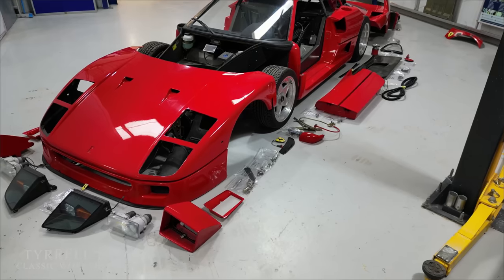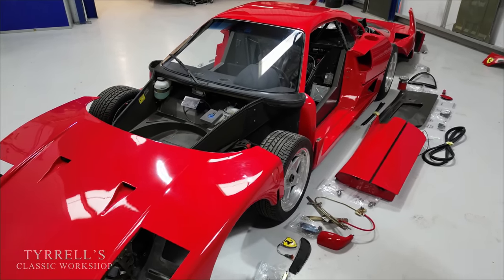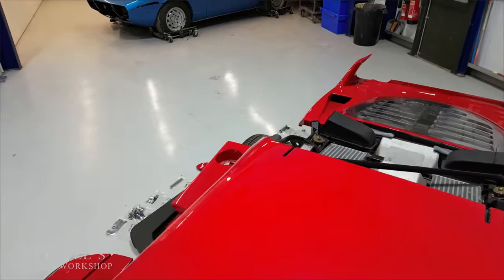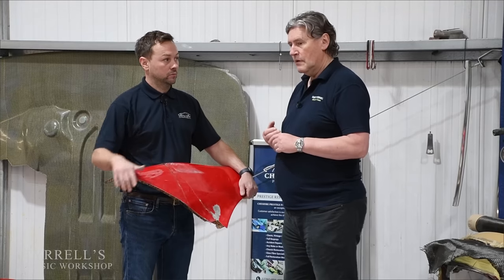Right, well... I've got a feeling it's from below. And I think I know where you're going with this. Yeah. Brakes. I think it's been used hard at some point. Yeah. Brakes haven't been left to cool. Either they ran it round the track, then didn't cool off the brakes. I think they've come in hot at some point and it stood hot.